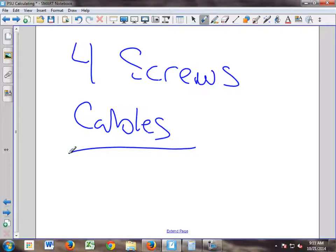Wish I had a video camera when I did my motorcycle engine, and maybe it would have gone back together right. But so I might do that. As I'm removing all the cables, I want to make sure I get all the cables plugged back in where they were. Things that students forget all the time. Students oftentimes forget the CD-ROM because I am not using the CD-ROM when I plug it back in. They usually do not forget the hard drive because when they're putting it back together, they usually remember to test it. The hard drive has to be connected. But I can leave it right where it is to pull out that P1 power connector and try the power and test the power.